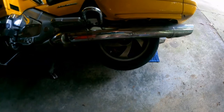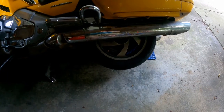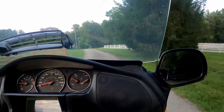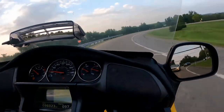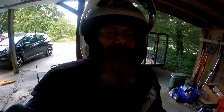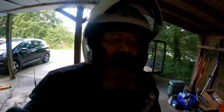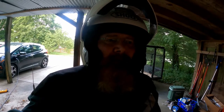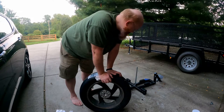Tire is back on. I'm going to try 33 PSI — that seems to be the pressure a Mini Cooper also uses for this size rear tire. Here I am on the initial ride with my new tire. For the record, that was a smooth ride — very plush. I can't say it's all the tire because I dropped about 8 pounds of pressure from the other tire. Very nice, very stable, very responsive. I think this tire is going to work out pretty well. I've only put about 10-15 miles on it, so I'm going to wait and see as I go to Sturgis how it holds up. Until my next adventure, this is Red Beard — see you on the road.